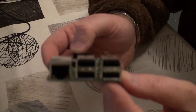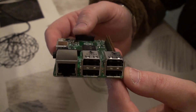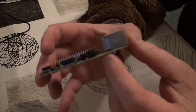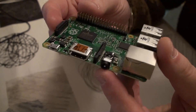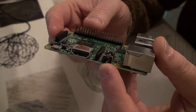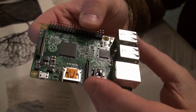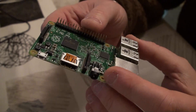We've got four USB ports there, which is USB 2 — not USB 3 — and we also have a 10/100 network port, it's not gigabit, which is a bit of a disappointment. I mean they could have put gigabit on it by now and just put it at a different price point. You've got the 3.5mm jack which can be used for composite video or audio, we have the HDMI port, we have the micro USB — more of a power supply really. And you've got your 40 pins for your outputs, which you can use to control various bits of hardware.